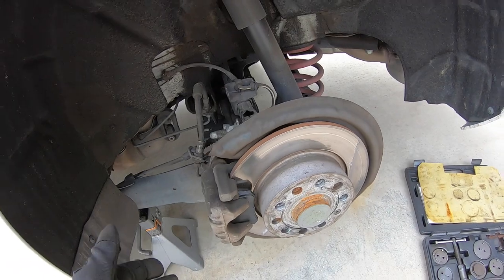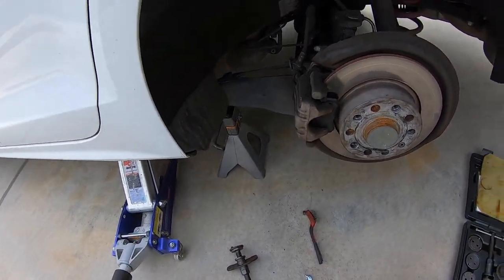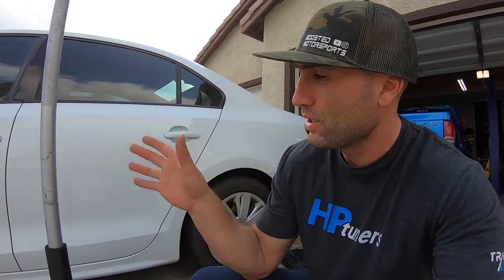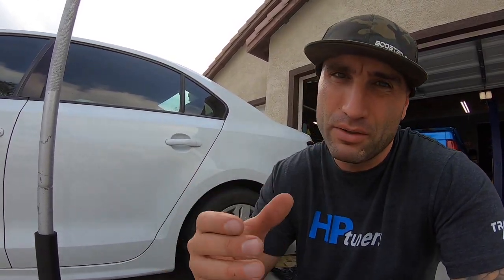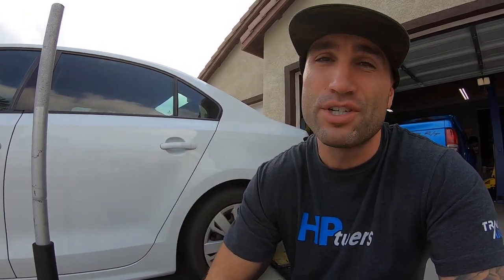Everything is reinstalled — we can put our wheel back on, double check that all the fasteners you removed are tight, put the wheel back on, take out the jack stand and the jack. Once you get everything on, before you take the vehicle out of park or put it in gear, make sure you pump your brakes. The other side is going to be the same so there's no point showing both sides. Work safe, use safety stands, make sure everything is tight. I can't stress enough — pump the brakes, because you pushed the piston in and it has to come back out to make up that difference. If you found this helpful give a thumbs up, check out the other videos, and subscribe.